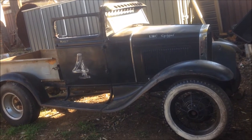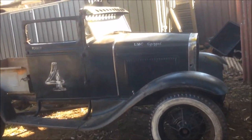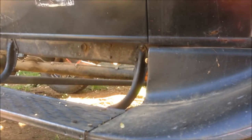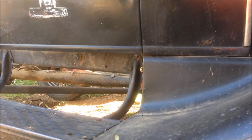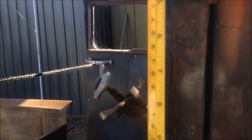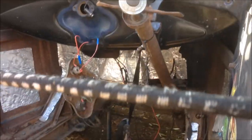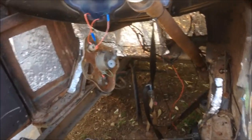The channel to do it full-fended is quite deep — we're talking 10 inches of channel. I don't know if it's going to work. We need to see that it's going to work. I've already got a four inch drop on this, and at eight and a half inches I'm just going to bring the door height way down. The biggest consideration is going to be floor height versus roof height and being able to sit in it comfortably.